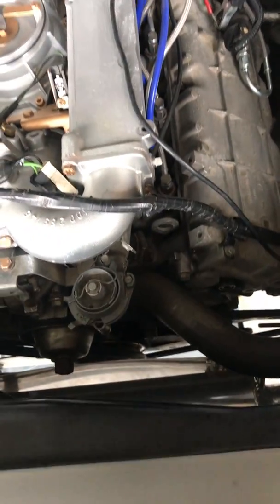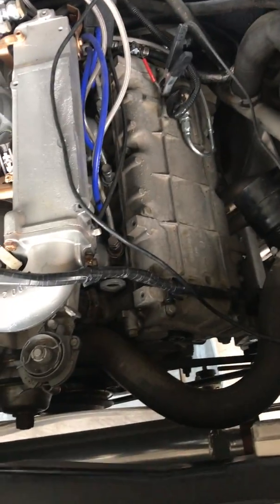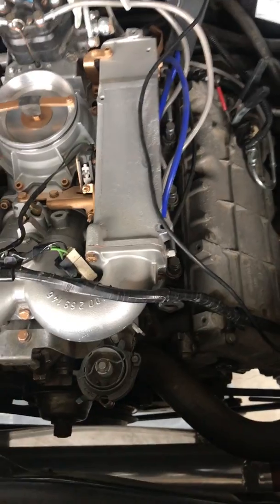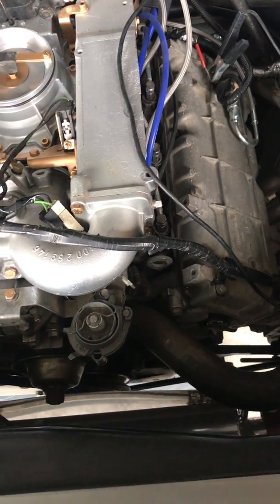I even thought it was the fuel injectors. I sent my old fuel injectors off to be cleaned, reinstalled them. That didn't fix the problem. So I went out and bought brand new ones from DMC and tested those, and those were spraying evenly, and installed those. But that didn't seem to solve the issue either.